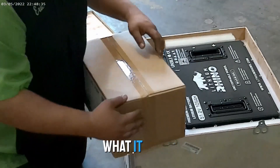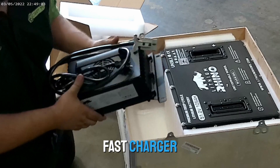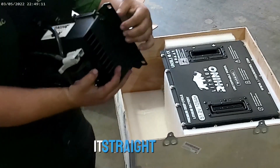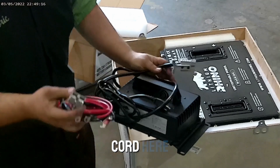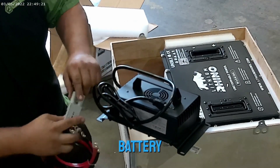Charger — we'll open that up and show you what it looks like. So this is the Rhino charger, 25-amp fast charger, high charging rate. Mount this guy on board — it's got little feet here, you can just screw it straight down. This is the other cord here, you just plug these guys in like that. And then your ring terminals go straight to the battery for the charger.